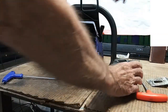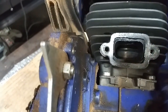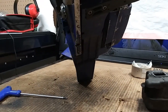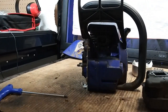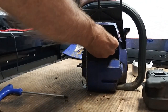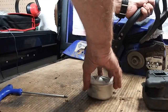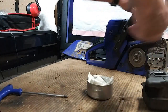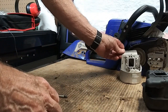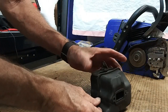There's a gasket against the jug and a gasket directly against the muffler, with the heat shield in between. Now look at this piston — this is after more than two and a half years of use, and that's what it looks like. I'd say that saw is doing a pretty good job. We're going to pop a plug in there to prevent contamination from getting into the crankcase or scarring the piston. Putting our screws in a little tin so we can keep track of them — I always try to keep track of parts as I take things apart.